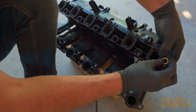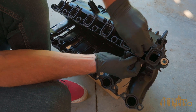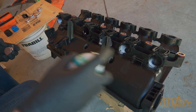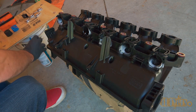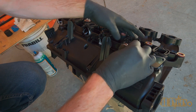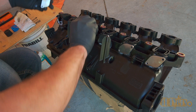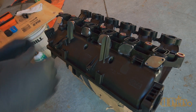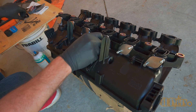Next was reinstalling those bolt sleeves. A silicone spray can be applied to each of the swirl flap openings — this will help make the installation of the gaskets much easier. Swirl flap caps are then installed. These caps are only intended for off-road use only; this is not a street legal modification and goes against laws which no longer make your vehicle fit for the road. Each of the Torx screws are then installed and tightened.